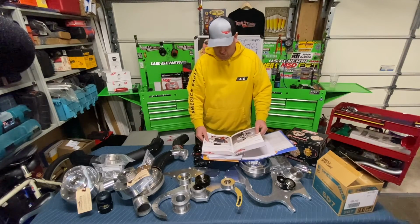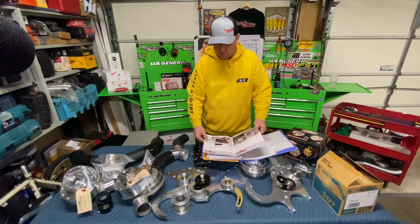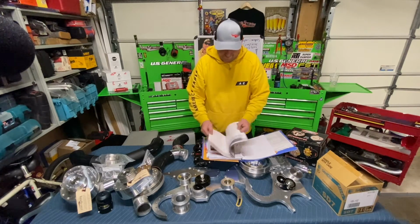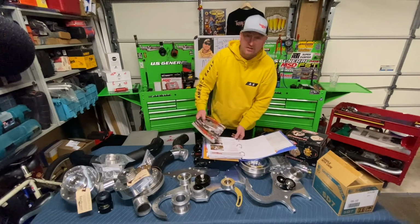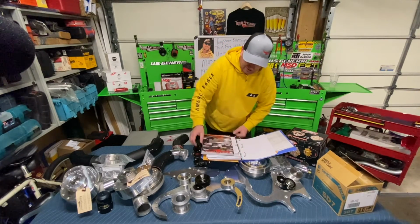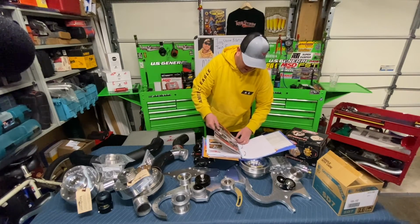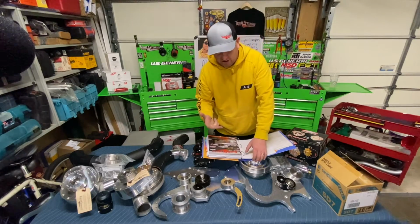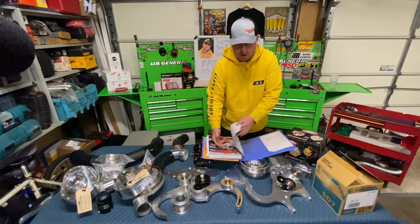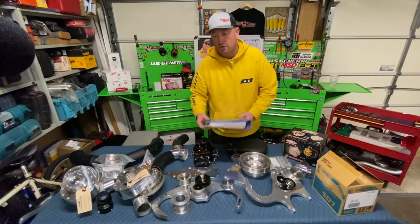I mean, it is so massive, the front end of that car. I'm hoping that I'm not going to have any issues and it's going to be a simple bolt on. But yeah, the real big thing with these types of systems, after doing my research online and just working on cars for a long time, is obviously your fuel, your spark, and you're going to need some sort of electronics to retard the timing when you're under boost.